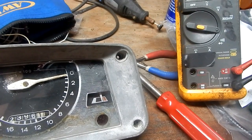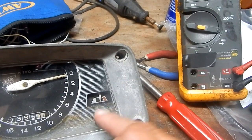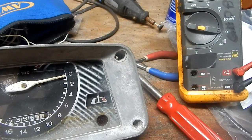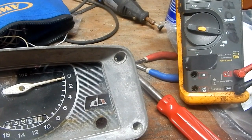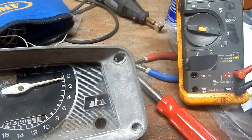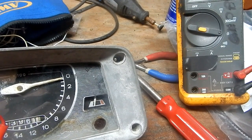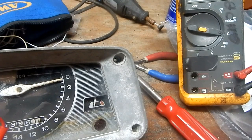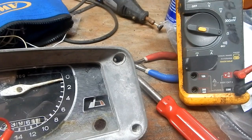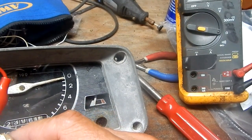I'm not really sure. I can't find the resistance value of the sending unit that's built in or that's in the engine, the thermistor. I do have that voltage stabilizer that I've read. The 12 volt input gets changed to a pulsing voltage for the indicators. And I also read that it's supposed to drop the voltage to 10 volts, or it drops it to 5. I really can't get any real information on this. So let me look at that voltage stabilizer and see what it's doing.